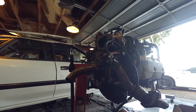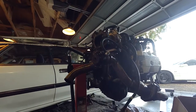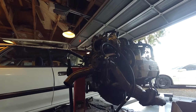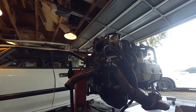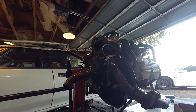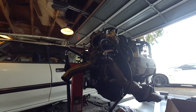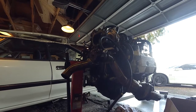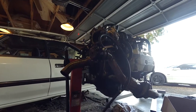I'll be changing the spring out in the wastegate. Right now I run straight spring pressure for boost control and it's been absolutely awesome — I have a nine pound spring in there and it is exactly nine pounds, never moves. Really consistent and I like running straight springs. I'll probably swap it out for either a one bar or just over one bar spring, so probably around 15 to 16 PSI. I need to talk to Rob the tuner and see how much boost he thinks this setup will take, because I am running stock 2.2 internals. Although people have made a lot more horsepower than I plan on making on stock 2.2 internals, I want this engine to last a long time. If I have to run a little less boost to make it last longer, I'll be fine with that.